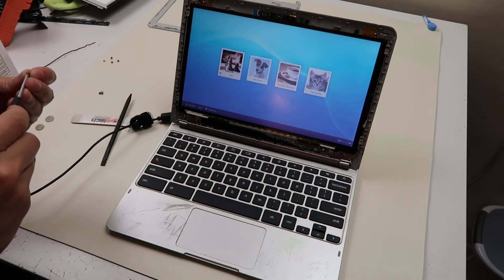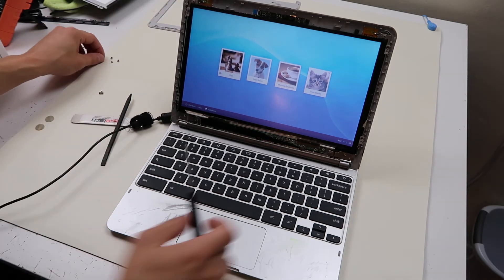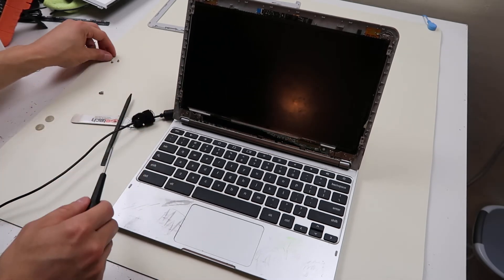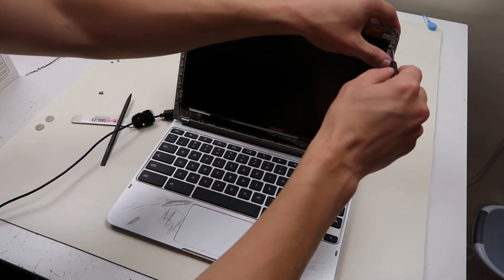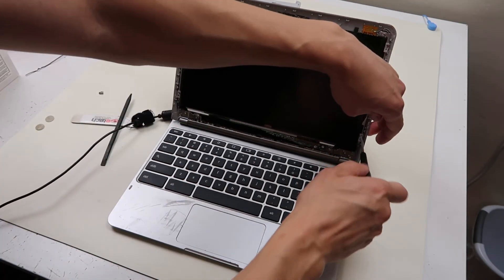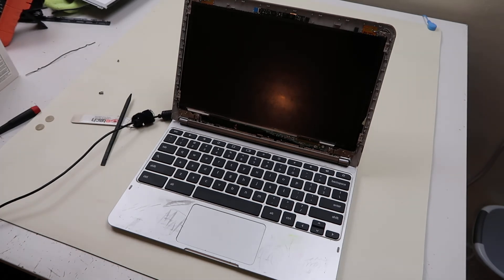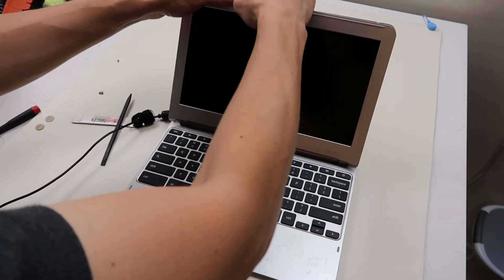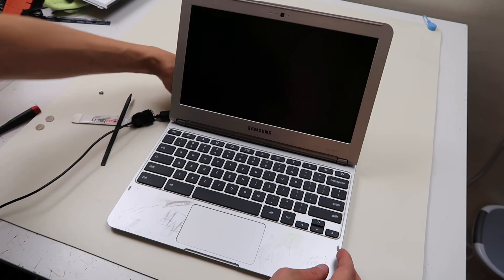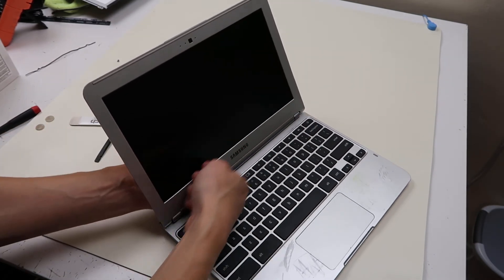So now you're just going to replace those screws — all four screws. Turn the computer off. Get that in there nice and secure. So again, as far as laptop LCD repair goes, this is not the worst one you could have. Some computers, you've got to take off the bottom case and go up into the motherboard area — it's horrible. So then you just take this bezel, line it up, and start snapping it in place. Careful when you're snapping it in not to push too hard and break the LCD that you just put in. All the way down the side, all the way down this side. The bottom corners are going to need a good push. Then just run your finger along here and get that in there flush.